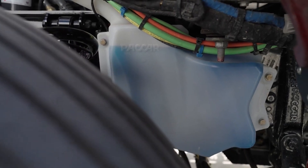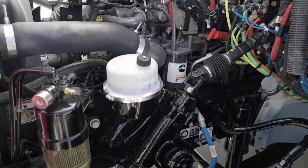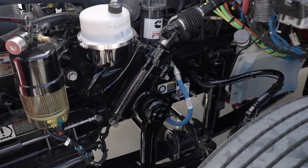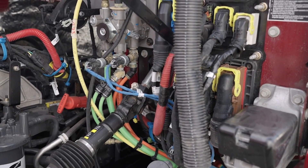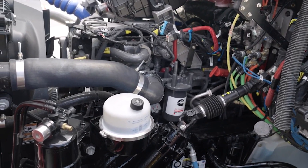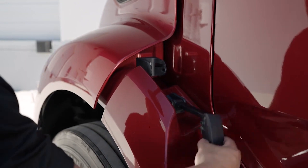Check for signs of wear on your windshield wipers periodically and check the washer fluid reservoir daily. Other frequent checks include the condition of the battery cables, hood latch, brake lines and hoses, and steering components. Check for chafing, rubbing, or corrosion, and make sure all clamps and straps needed to hold this equipment in place are present and in working order. To close the hood, carefully lower it back into place and reconnect the latches.